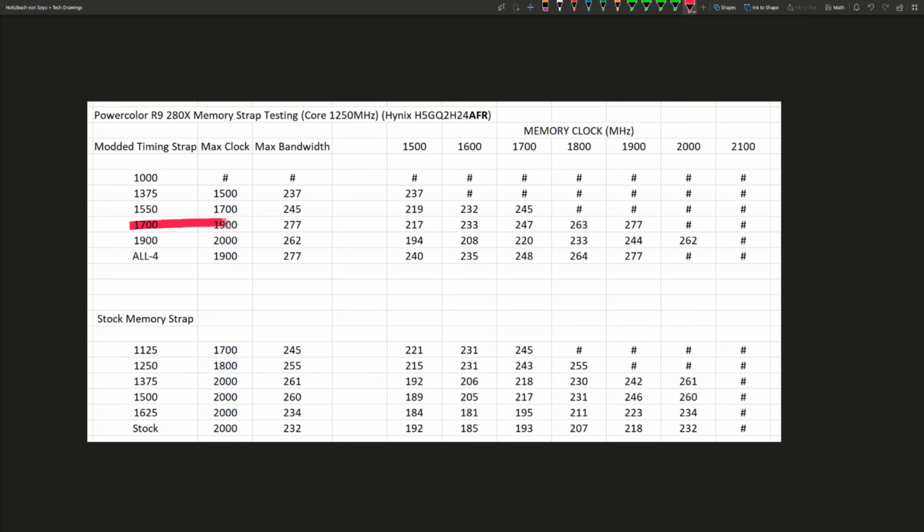So the result is, run the custom 1700 MHz strap. I hope I won't forget to put the custom straps I was running in the description. If I forget, just write a comment, and then I'm either going to fix the description or write a comment myself with the memory straps. And there's going to be a tutorial on how to do this mod, because Bullseye has a tutorial, but he left out one crucial step, which might be because he just forgot, since if you do anything with BIOS modding, you always do that, so maybe he's so used to it, or assumed everyone would know it. I didn't. I needed some help pulling this mod off, so I guess that's why I'm making the video.